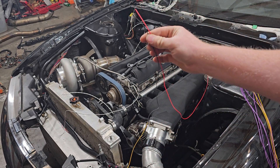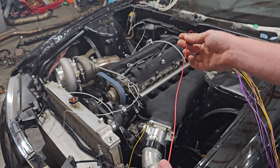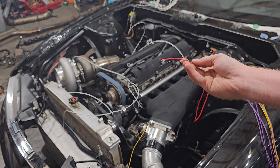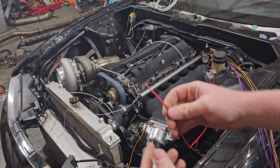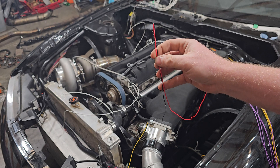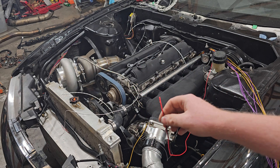These right here will be going to the TPS. And if for whatever reason it needs a 5V somewhere, such as a sensor for fuel pressure or oil pressure, we can tap into it to use that. There is no issue with that — it is just basically a reading to determine different values. 5V is a little bit different than 12V and uses ground as a metric.